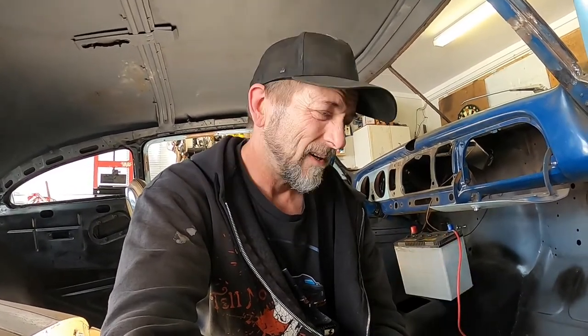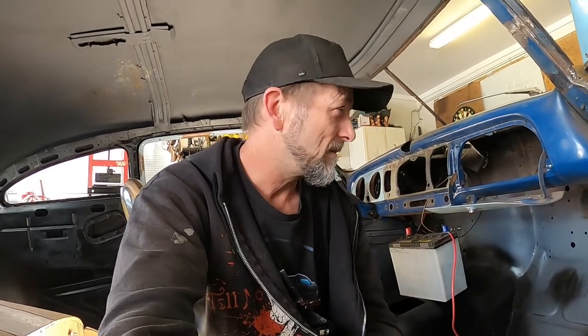It's just a bit of 3mm or 1/8 inch flat bar, 15mm or 1/2 inch, or 3/4 inch, something like that. I don't know, it's only about that wide. Yeah, just quickly folded them up, drilled a hole, cut the angles on it, and whacked them up there so I could clamp those things in place.